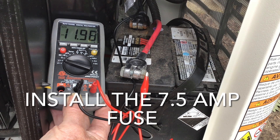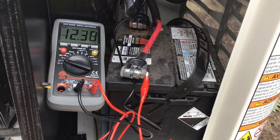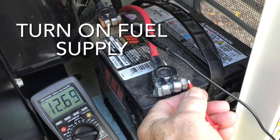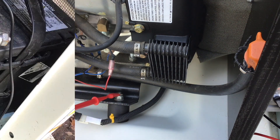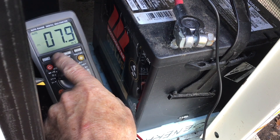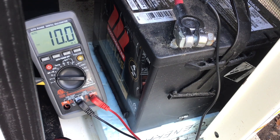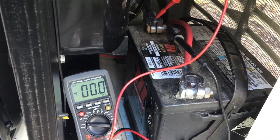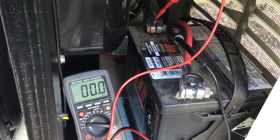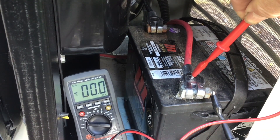The first test I'm going to perform is to see how much the voltage drops on the battery when I crank the motor. I have turned off the fuel supply so it doesn't start. The voltage drop was 1.75 volts, which is perfectly acceptable — two volts or less is what we're looking for. Now we're going to do a voltage drop test on the negative battery cable: one lead goes to the negative battery post and the other to the motor mount stud. Set the multimeter to read in millivolts DC. Once stabilized, we're looking around 9.9–10 millivolts, which is very good. These numbers are low because the generator is running. The next test checks between the negative post and the negative battery cable — there is no voltage drop, so the post and the cable are acting as one. The same test on the positive cable shows exactly the same results.